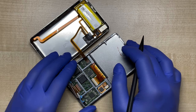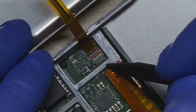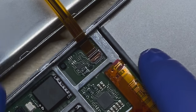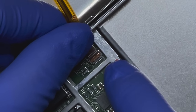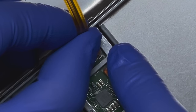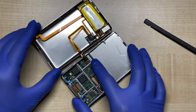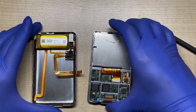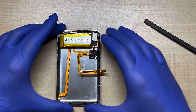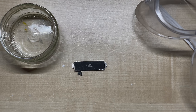With the hard drive out of the way, we can now disconnect the headphone ribbon cable. This time, the clip is on the same side as the ribbon, and not the opposite side. We can just flip it up, and then slide the cable out. Sometimes these cables are held down by adhesive on the underside, so just gently wiggle it around while pulling to the left. And eventually the cable will come out. Now we can put the front half away, because we won't be working on that. Everything with the Taptic Engine will take place on this back half here.